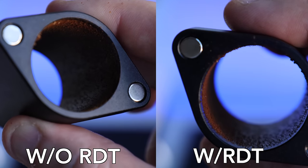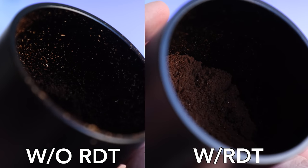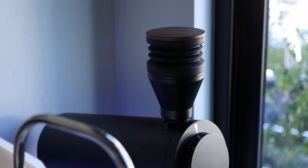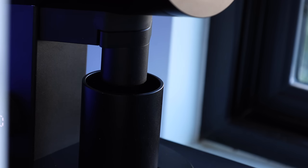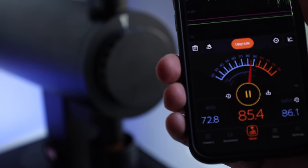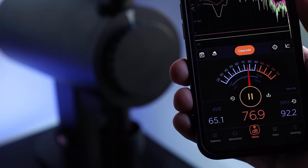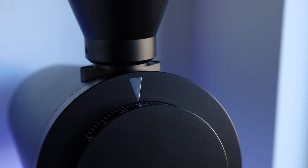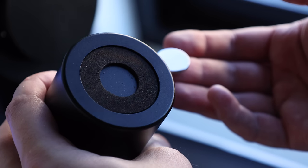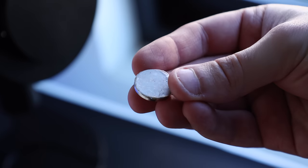I prefer RDT for a few reasons: it seems slightly more effective at reducing static buildup in the chute and makes a clear difference in the dosing cup. I also find the bellows a relatively unattractive and awkward-looking addition to nearly every grinder, and to thoroughly clear out the dead space it needs a few solid taps, often just kicking a burst of air into the dosing cup and kicking up grinds around my workspace. On the topic of workspace comfort: noise. The 83V hits similar peaks to its predecessor — around 85 decibels at 1600 RPM and 75 decibels at 300. Amidst the quality materials, there are a couple of cheap points — an odd reflective sticker used to mark the dial center, and double-sided tape holding the magnet on the bottom of the dosing cup, which fell off after just a few days of use.